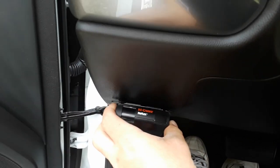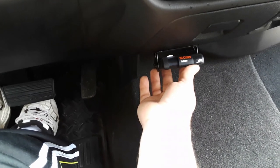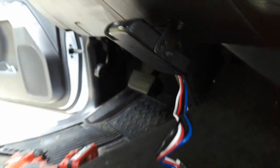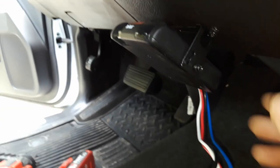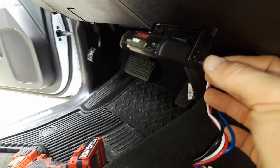I'm checking whether the steering wheel is going to block my view if I mount it on the right side just under my knee, and I don't know if I really want it on the left side either. It does need to be within easy reach, and you also want to be able to see the display, so closer to the middle looks like the best placement. Before mounting I checked that the adapter wire was long enough, and I have it angled up a bit so I can read the display — this one can actually be angled up to 75 degrees and still function properly. From here I need to plug the controller into the harness and then secure the wire up under the dash so it's not hanging down.